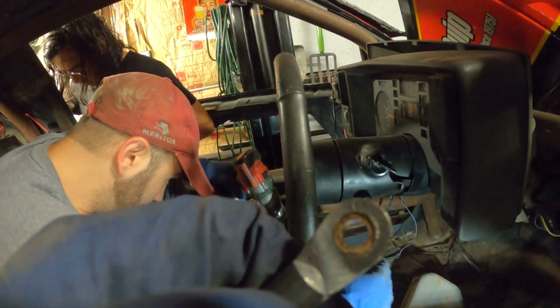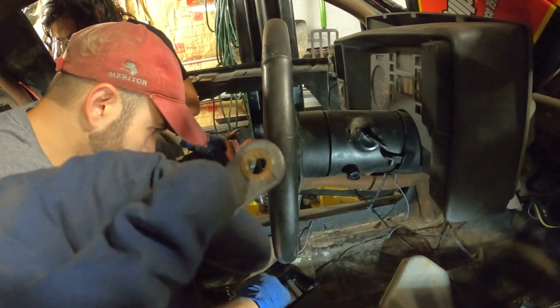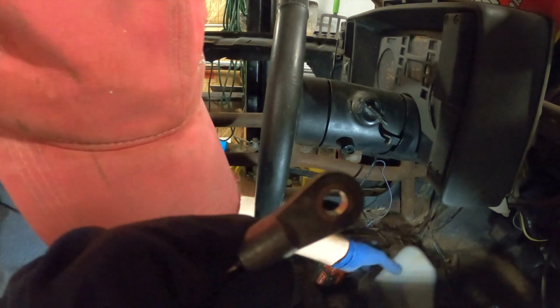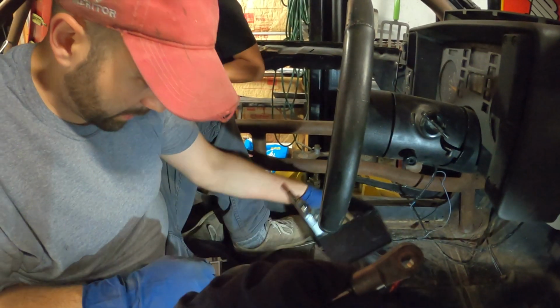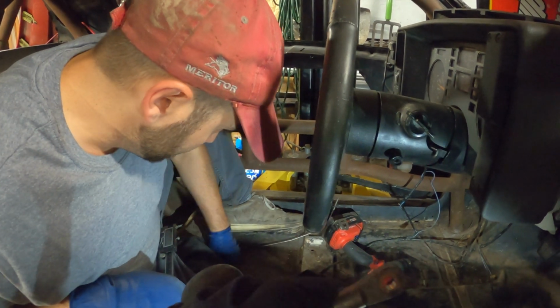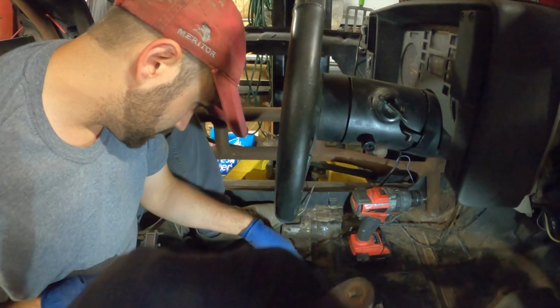What we are doing here is we're just machining it, drilling it out a little bit to make it fit perfectly. These came from Fiero store, and they are slightly undersized. Oversized, undersized? Undersized. Which is the right thing to do. If you had a bushing in one of these things, then your pins here would be undersized, and you would actually get clunking when you're shifting. So we're just making them fit in our application here. So this should work.